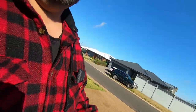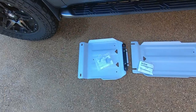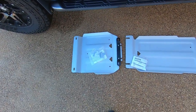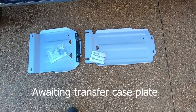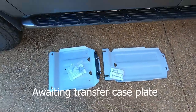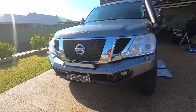One thing with the Patrols I do not like is the underbody protection — the sump is totally exposed. I've got some bash plates from Repco. That's the engine bash plate and that's your transmission bash plate. What I like about Repco is you can buy them separately, because with the rhino bar it comes with some bash plates.